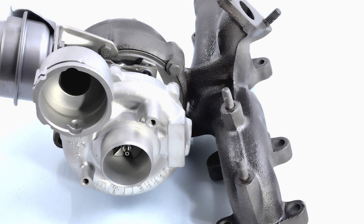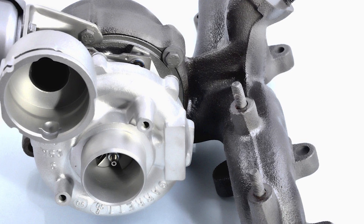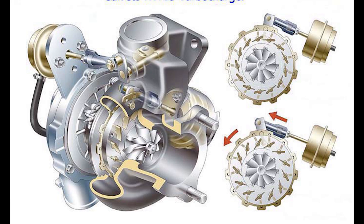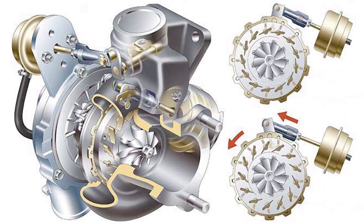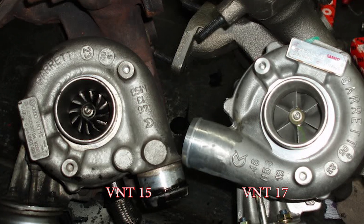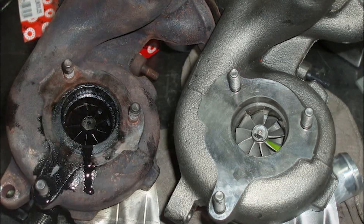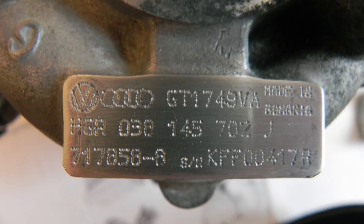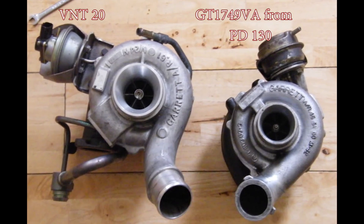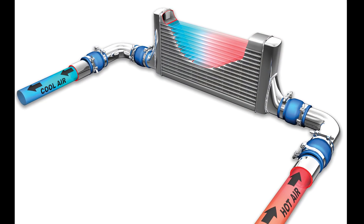Now that you've got upgraded nozzles and extra fuel going in, you'll be running a bit rich, so you're going to want a bigger turbo. A popular option is to go for the next size up. On my car I've got a VNT15 turbo, and the common upgrade is the VNT17 — one version came from the PD130 engine and the VNT17 from the PD150. You choose a turbo appropriate to your power goals, or you can go right to the other end of the scale with something like a VNT20 or hybrid turbos.